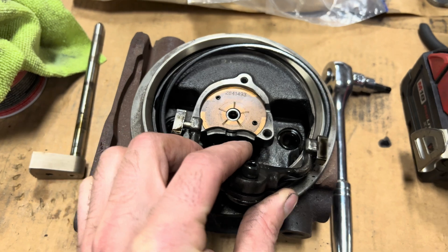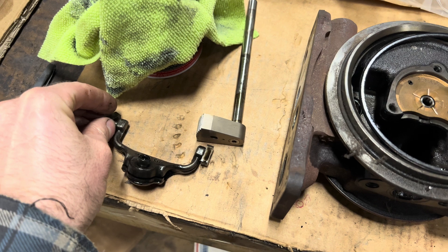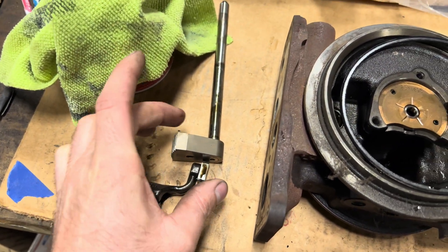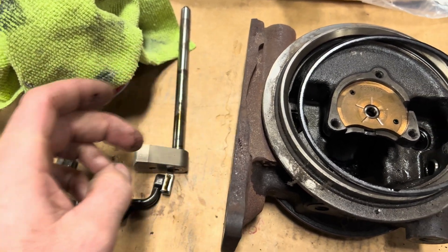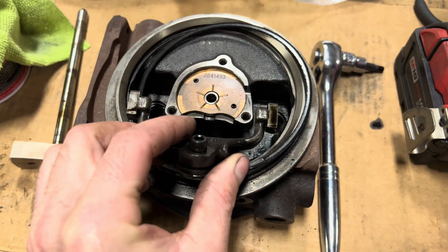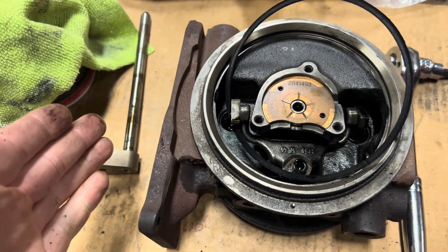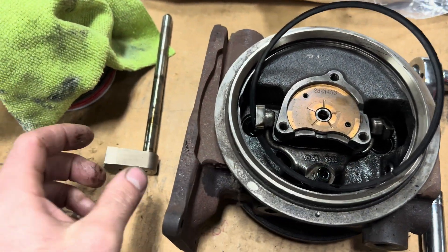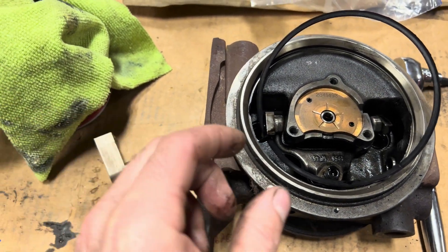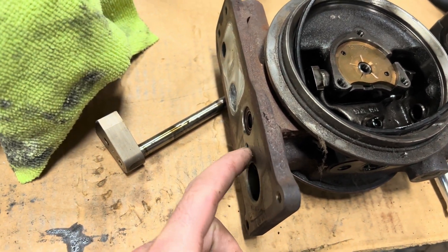For the VE model, these are the parts that go all the way over, and the VGT gear goes all the way in. That slop in between the blocks means it moves across a lot, which will throw off your clearance between this and the bearing housing if you have it mounted all the way over in one direction. By positioning it all the way over, you're putting it at the maximum distance it can move, because once you tighten that down you have a lot of free play movement in and out.